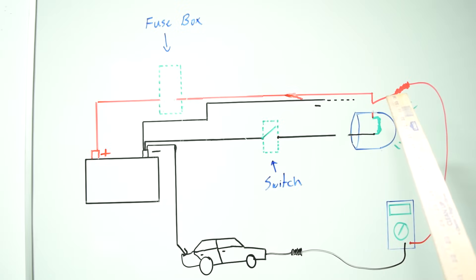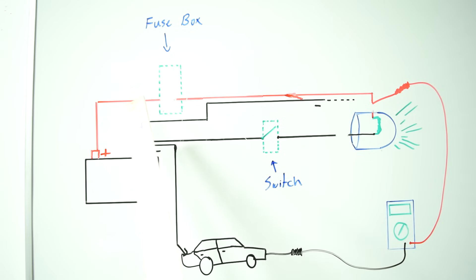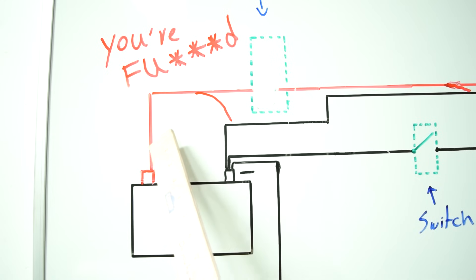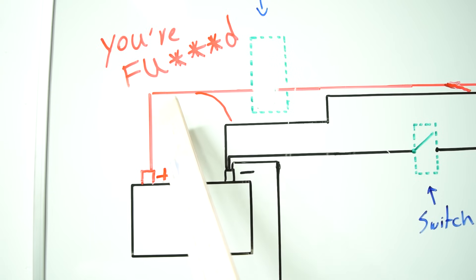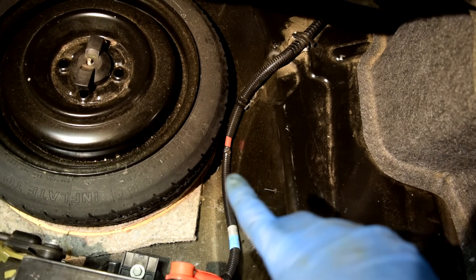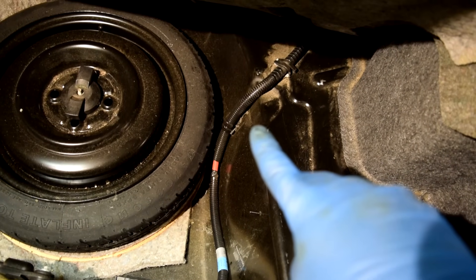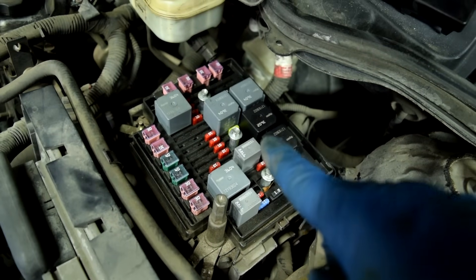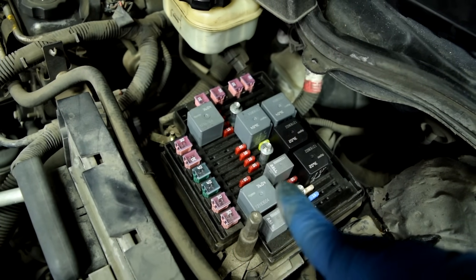Now, this checks for a short to ground on this wire — but what if you have a short to ground on the wire or cable that comes from your battery to your fuse box? If that happens you're not going to blow a fuse, and since there's no fuse there, current is just going to get shorted through the circuit and this cable or wire is probably going to overheat and maybe even catch on fire. But don't be alarmed too much — automotive manufacturers know this and provide sufficient insulation on that cable from the positive side of your battery to your junction box. Once current gets to the junction box it gets split off to different circuits, and each circuit is protected by a fuse.